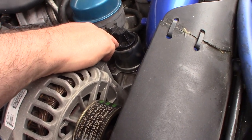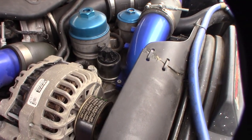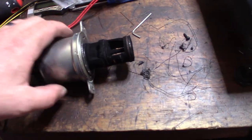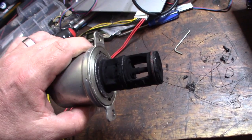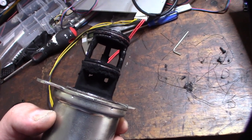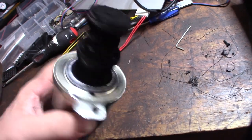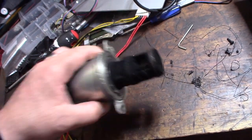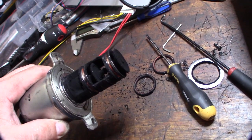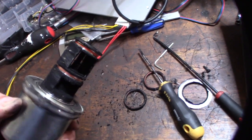I'm going to take this off and clean it, even though it's not even a couple years old. I clean it every year or so, because if your EGR valve is sticking you're going to have some serious issues with idle quality. I just cleaned this thing about a year ago and look at all that soot already — this stuff is hard to get off your hands too by the way. See how the thing's staying open like that? That's not supposed to be like that; it's supposed to close on its own. That's a serious issue — I definitely have a sticky valve in there.